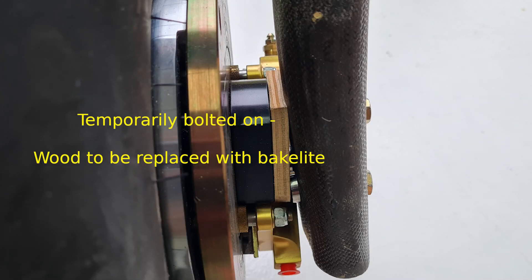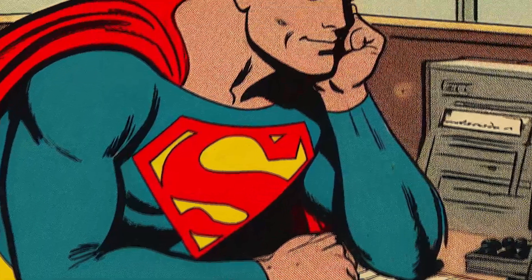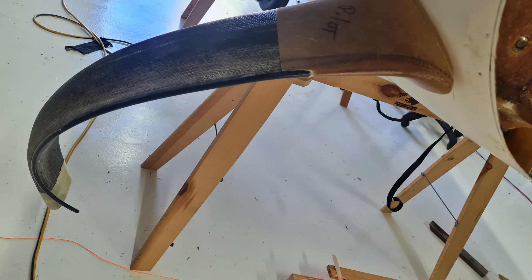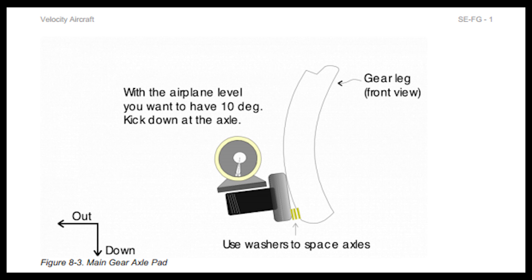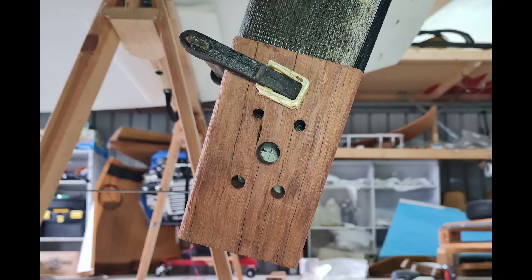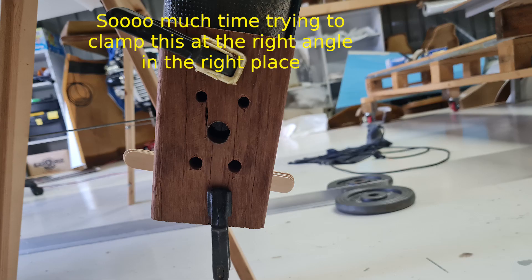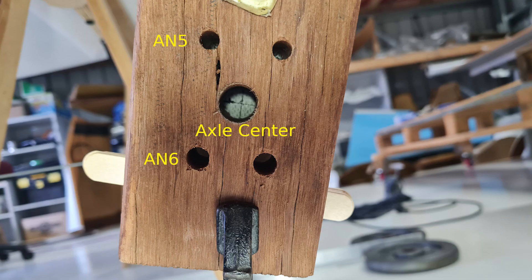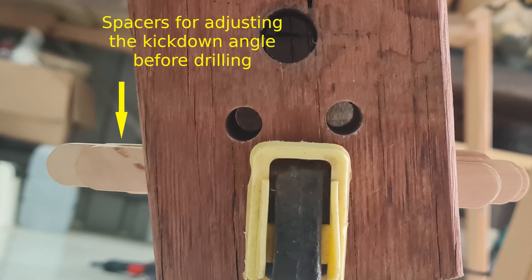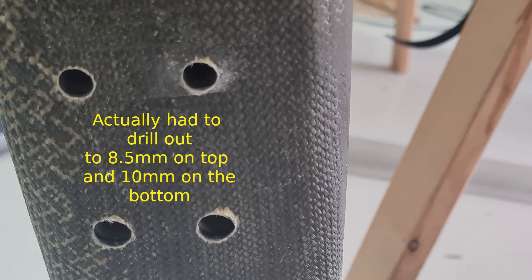The last step is to attach the axles onto the end of the legs — here is another opportunity to do something perfectly the first time. The first thing I noticed was that I couldn't just drill my holes at right angles to the gear. The axles need to have a certain angle and the wheels need to have a certain toe-in angle. This block of wood was my second attempt at making a template for the axle holes. The issue with aircraft building is the lack of clearance between bolts and holes. I've grown up with the metric system where the M10 bolt fits easily into an M10 hole — that's because the bolt is not really 10mm, it's 9.5, so you've got wiggle room.